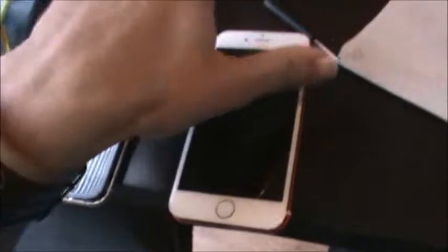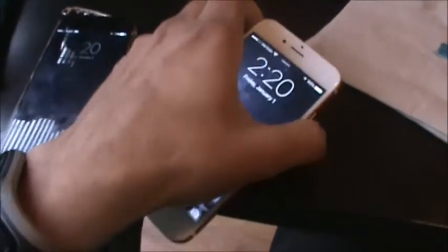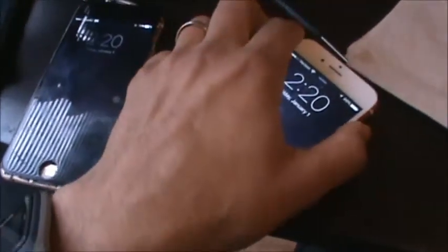So the home button was ripped off, no Touch ID, so I'm going to try to put it in DFU mode. Use my screen for my custom iPhone 6, restore it. Now, I'm afraid it might get an iTunes 53 restore error, but we're going to try it anyways because I have nothing to lose, right? So, here we go. I'm about to switch out the screen so I can at least have my home button Touch ID, try to DFU restore on there.